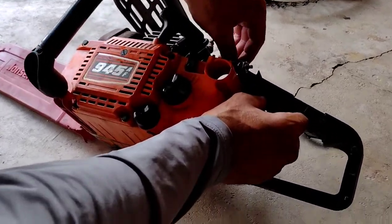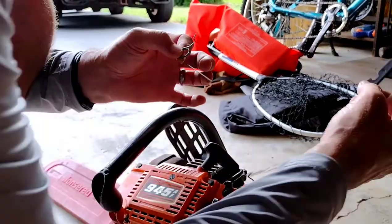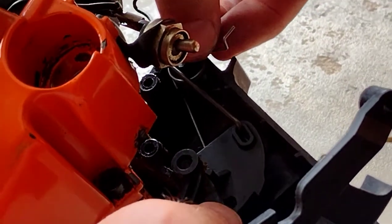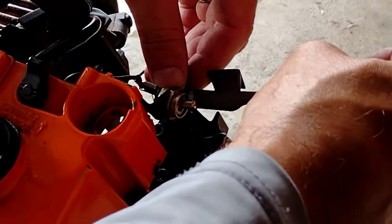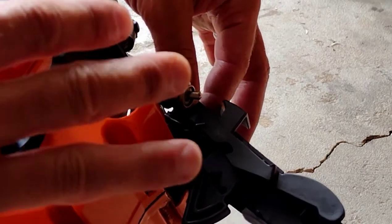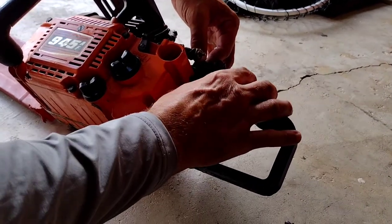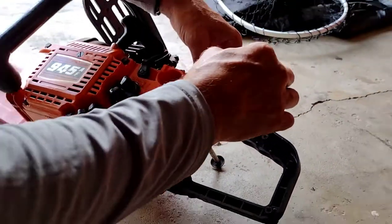The throttle linkage goes through the top here, through the hole, and the pin goes down here. Now for the spring: the top comes over here — there's a pin right here that this goes down through — it goes behind the back of that, sits down in that little notch, and the center of the spring goes down under this little pin. Then this piece sits on that pin; get it all lined up, it comes down and sits inside like that. You have to keep tension on it with your thumb while grabbing the left piece of the handle and slipping everything down together the way we pulled it off. It takes a lot of work, but that's the whole reason I made this clip — because there's nothing out there on YouTube about this.